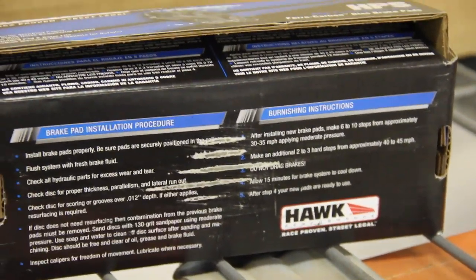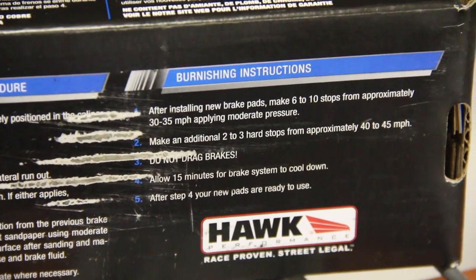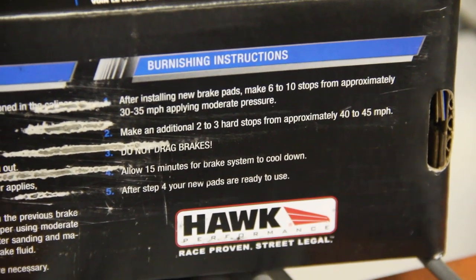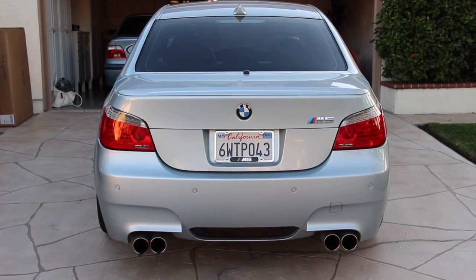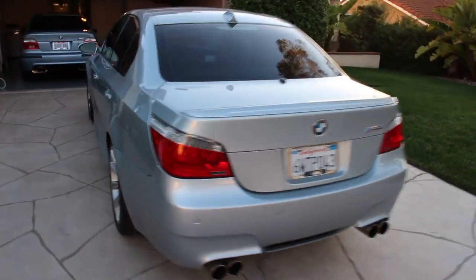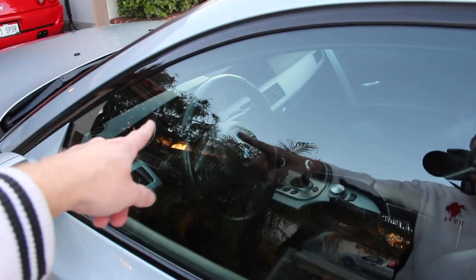Before you attempt to start or drive the car, you want to bed the brakes. Don't drive it to the grocery store and then bed them later - you need to bed or burnish the pads immediately on the new rotors. These are the instructions from Hawk; if your specific pads didn't come with any instructions, these are reasonable to use. Read and follow those instructions. Check your fluid and you'll be good. After the bedding and cooling process, your brakes are broken in and ready for another 100,000 miles. You'll also want to go ahead and reset the service indicator inside the car. I will leave a link to a resource in the description. You can fairly easily do it yourself using the pushers on the instrument cluster, and you'll want to do the front and rear brakes separately if you did both through this DIY.